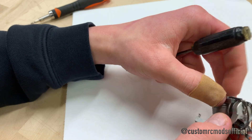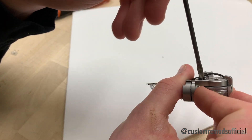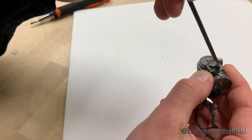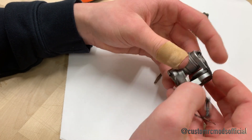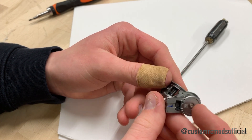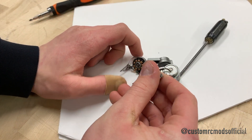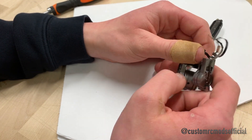Now we're going to go ahead and snake it down to the final part. You're going to have to move the video cable out of the way and try to pull it up from the side. I really don't want to be too forceful. I actually broke the pads on the inside of a different Mavic gimbal — you can see they're awkwardly spaced — because I was a little bit too finicky, and I actually broke a $60 part. So make sure that you are very careful with this. I'm going to try to get this off off camera.